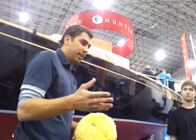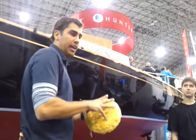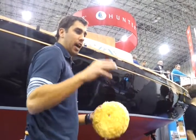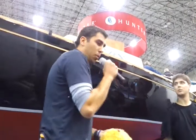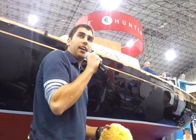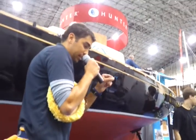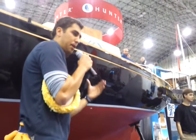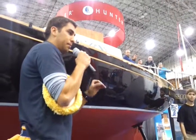The other thing, when you're doing the non-skid, you don't have to worry as much about swirl marks. It's not going to show. You can hit it with heavier stuff. So, just from what we've been talking about here, I would hit that with a white wool pad, buff it just like we did here. When you're done buffing, you're going to have a lot in your non-skid. You're going to have to go off with a rag, maybe a brush, to get all that compound out of there. But it is possible to restore it the same way. We're talking about the same thing.